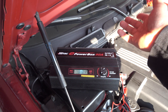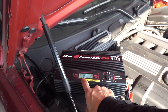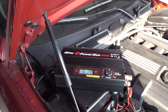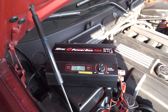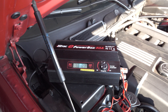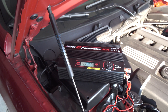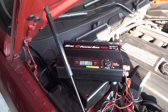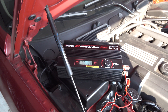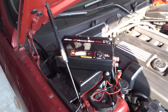The downside to this power supply is that it's 15 to 30 volts and the lowest I can set it to is about 14.2 — that's just barely enough. I would still like to have the possibility of turning this down to say 12 volts, just for maybe other projects. But that's approximately what the power requirements are on these cars.